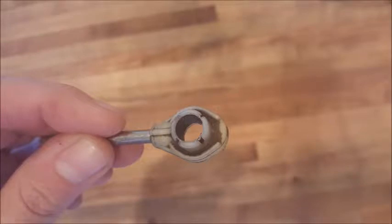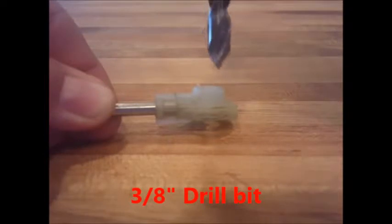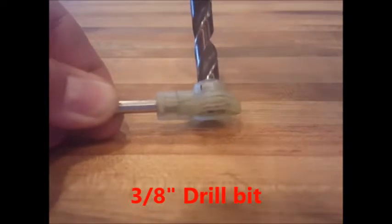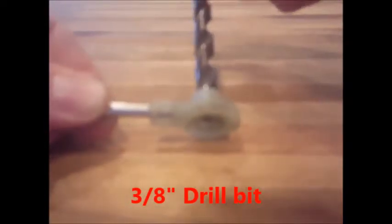If when you're drilling out with the 11/32" drill bit the bushing begins to chunk, comes out in several pieces, falls apart, or comes out entirely, rather than using the black bushing you will use the green bushing. To prepare for the green bushing, just drill out using a 3/8" drill bit — just the top of the cable end.